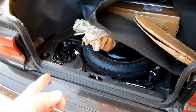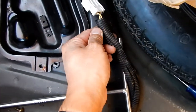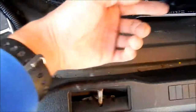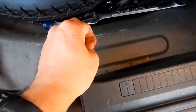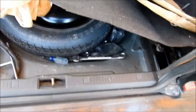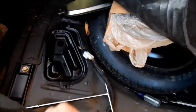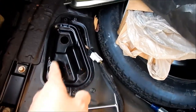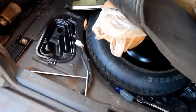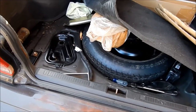The fuel mods done on this Galant are: the fuel pump rewire — the previous owner did that, their handiwork — with a clean plug-in connector that even has the wire tucked into the harness so it looks OEM. And now we have the Walbro 190 fuel pump. I can feel comfortable that we can boost at least stock levels and the engine won't blow up.